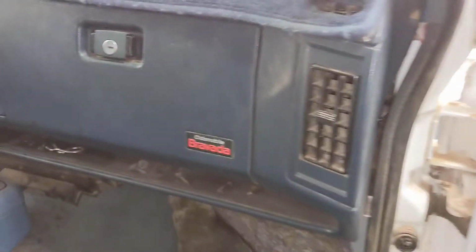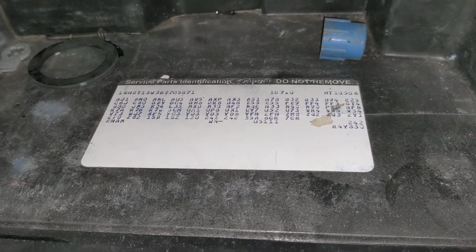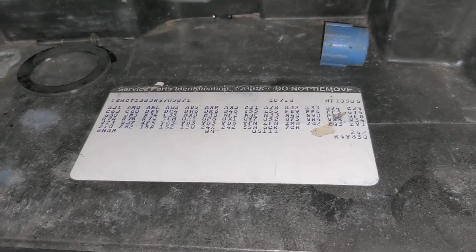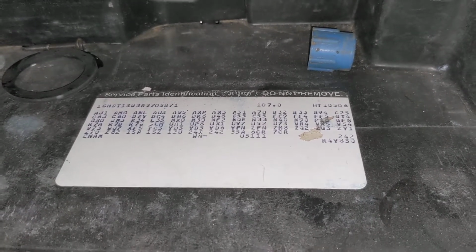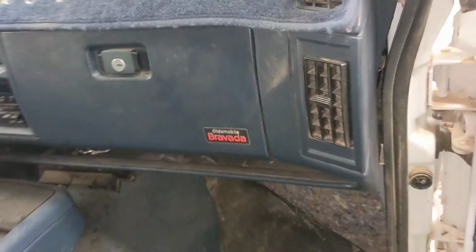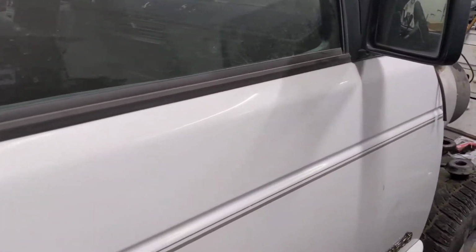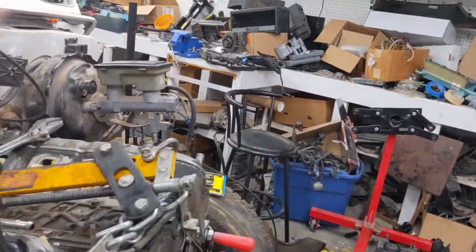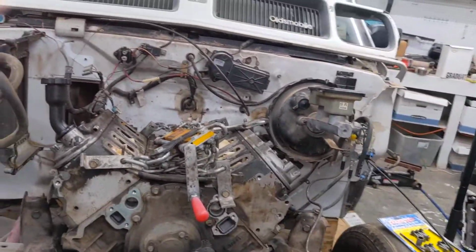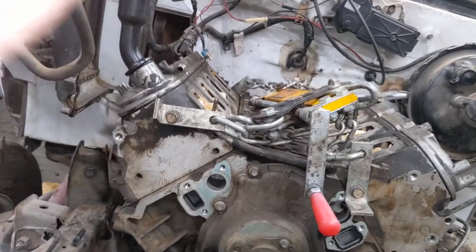So if you look, it has some pretty neat options. Specifically, of course, most people, every time they think of it, it has G80. Yes, it's a G80. It is also a GT4, which means it has 373 gears. So this will be a 4L60 with 373 gears and a 6-liter aluminum engine. Both the engine and the transmission came from the same Gen 4 truck, a 2008. I don't know if it was a Sierra or a Silverado, but it's aluminum Gen 4, also known as an L76, not the car version, the truck version.